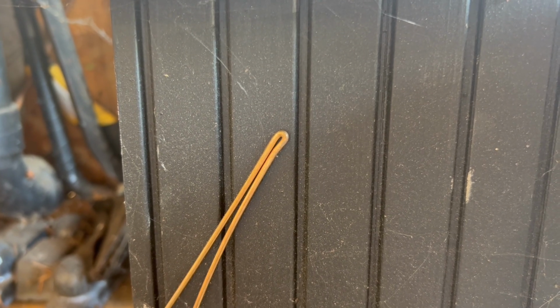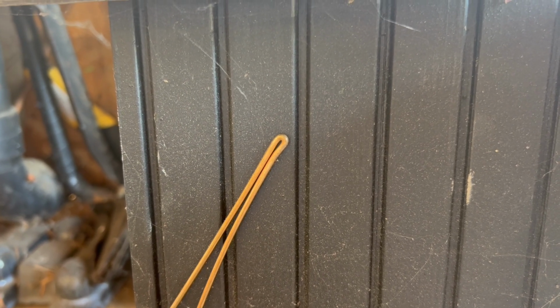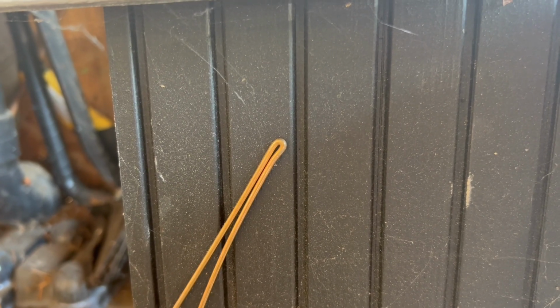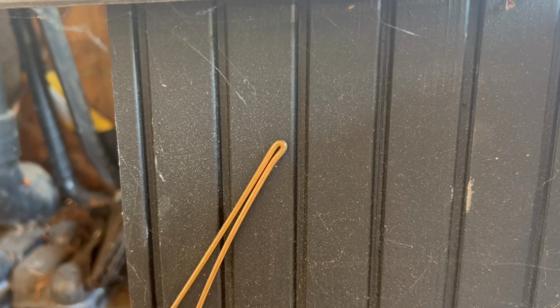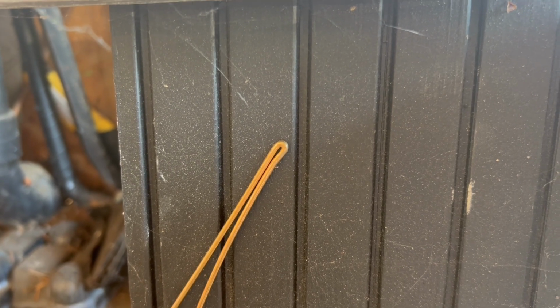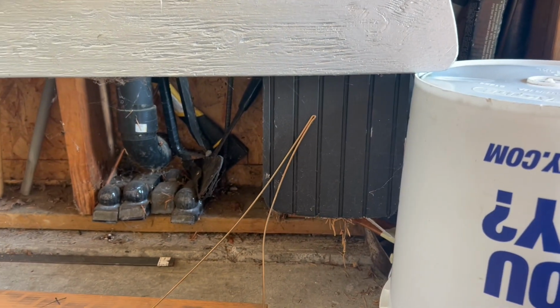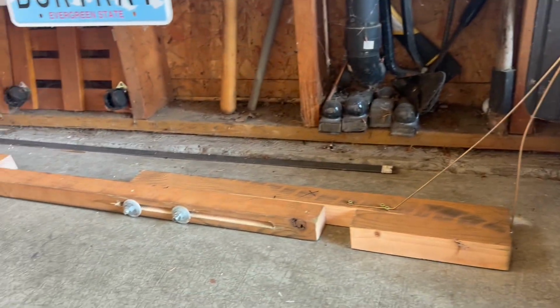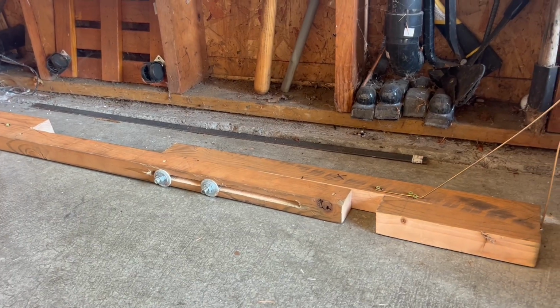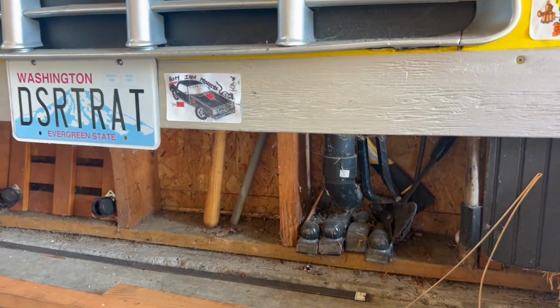It'll make it look like this. So I know that I'm wider on the back side of that tire than I am on the front side. Then I know I'm toed in anywhere between a 16th and an 1/8. And so there we go. Anyways, nice little simple gauge. Slides in, locks down, and it doesn't lie.